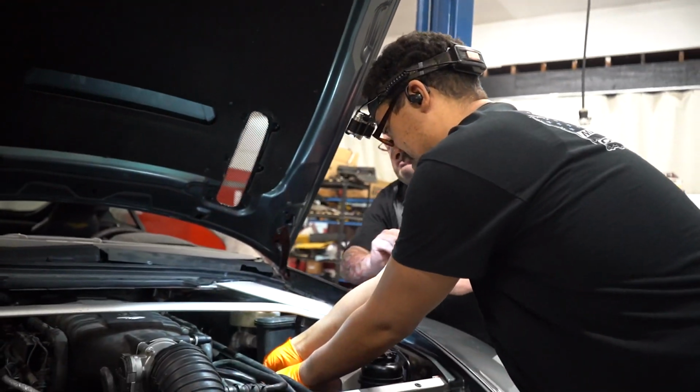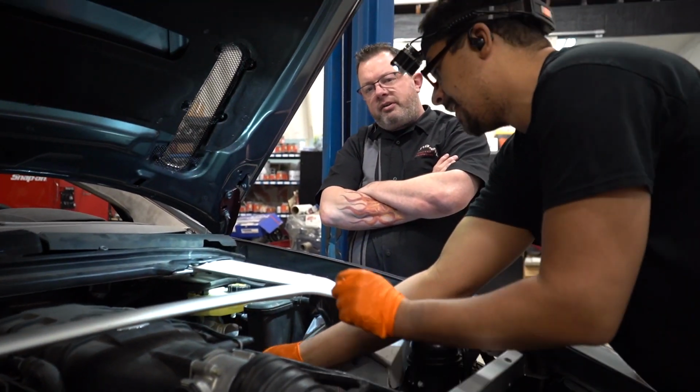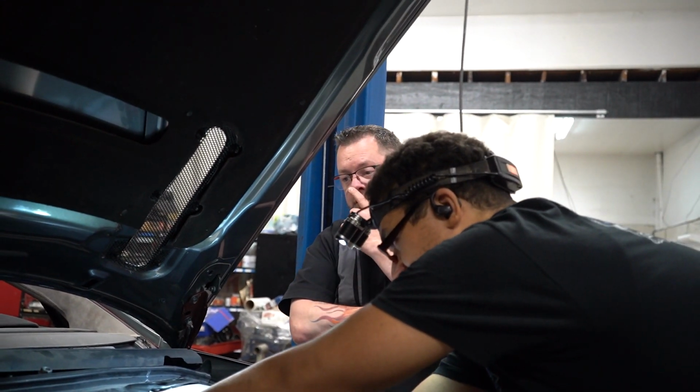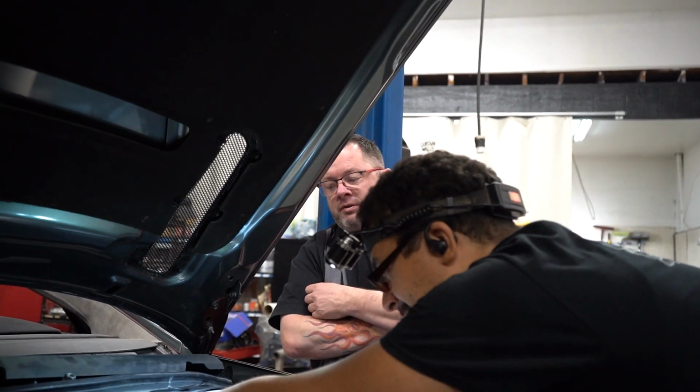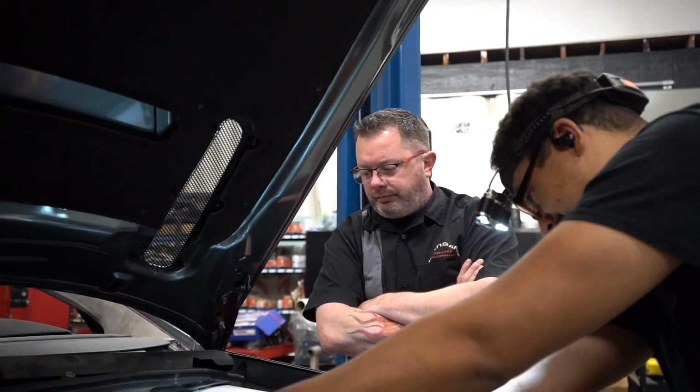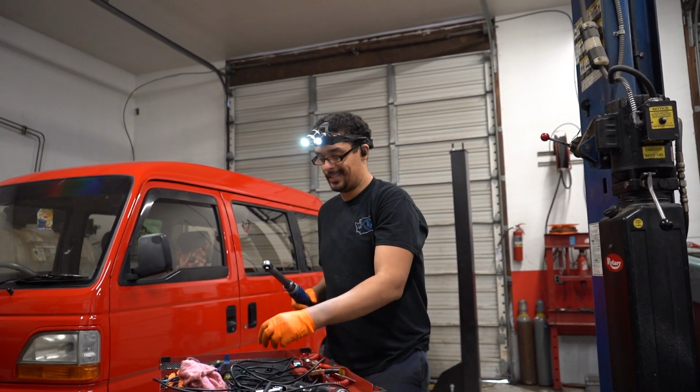Gotcha. That explains it. So in our earlier videos, when we were first trying to crank the engine over before we ever started it, every time we tried to crank it, we were blowing a fuse. We thought it was a ground issue. Apparently, it was the way we had the starter wired. Kind of put the key in and see if we get a good, solid cranking cadence.